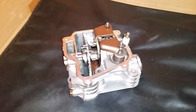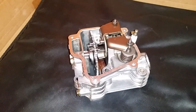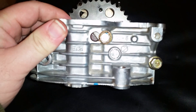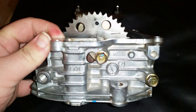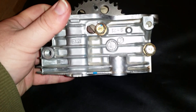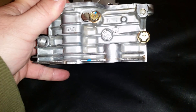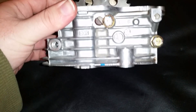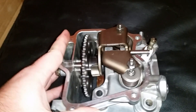Here is the cylinder head for the Subaru EX21 engine, just a nice overview for reference. You can see the EX21 casting, which you would probably find on just about every cylinder head — it's a good identifying mark. A lot of times the other engines, the EX13 and so on, have the same location, so that's a quick identifier somewhere on the casting.